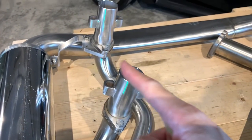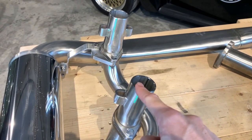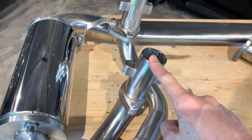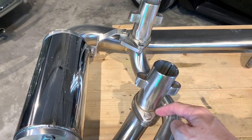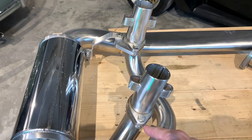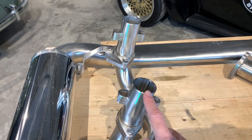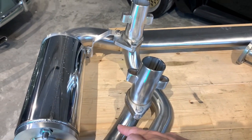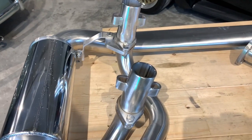This is the oval port, so if you have the CJ, this is correct. We do it in two pieces, using the Porsche 911 flange and gasket, so it can be pre-installed when you assemble the engine, and the exhaust can be installed later when the engine is in the car.